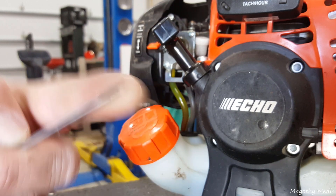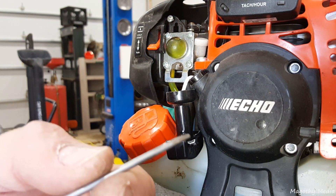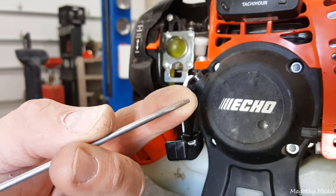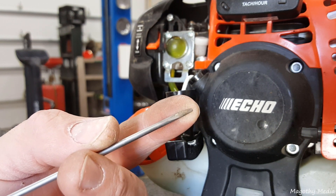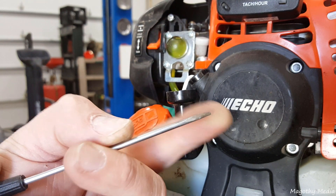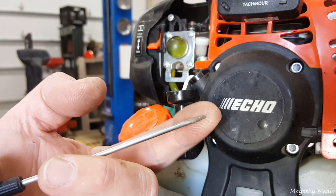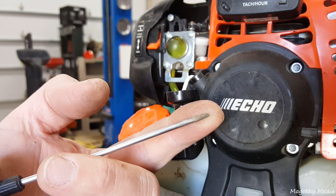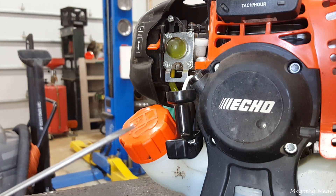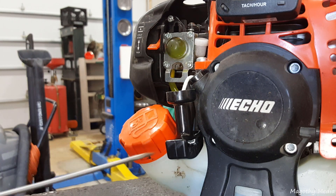It's narrowed down but it's also sharpened to a point. Now this plug here is being particularly difficult. I'm going to heat up the screwdriver to push through the plug. Sometimes you can just stab through it if the Torx bits have failed and you're on this step, but I don't want to push too much harder — even though this is sharpened — I don't want to end up shattering the plug and be trying to pick out pieces. So off camera I'm just going to heat it up with a little handheld torch. Don't want to direct flame towards this, for obvious reasons.